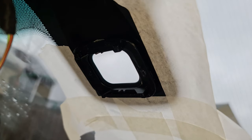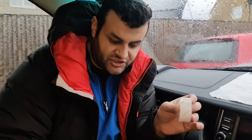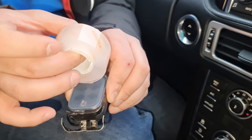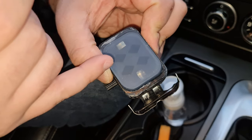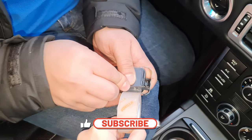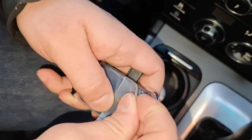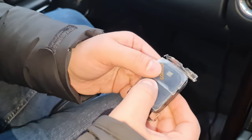This is my solution. A few things about this tape: it's transparent — crystal clear — and it's double-sided and thick. Can you see how thick it is? It's not thin tape, so it should fill the gap between the sensor and the glass. My plan is to put one piece here and one here. There are four dots and the sensor — as long as I'm in between them it should be fine. Now I'm pressing it in, making sure there are no bubbles, and making sure the pieces don't overlap but are next to each other with no gaps. Then I'll trim the excess.